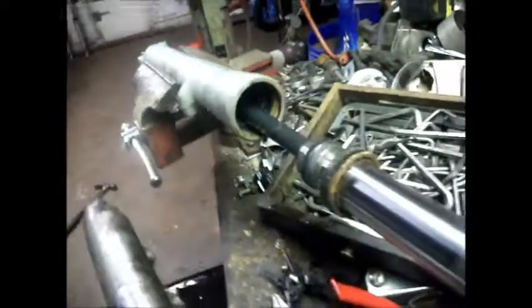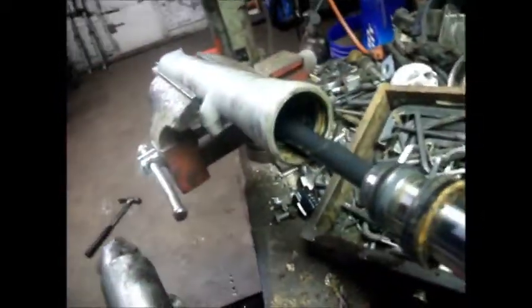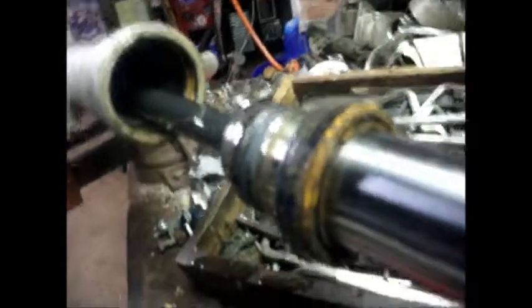What you've got to do is just grab that side, make sure that's tight in the vise, and just keep pushing it in. But don't push it too far because the oil squirts out of this end — caught most of it though. Just push it in, don't push it all the way, and just tug on it hard. The seal's press fit in there, so it's a tight fit, but it does come out. Now just let that one keep draining out before you start the other one — it's less of a mess.